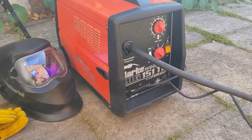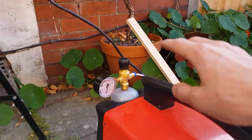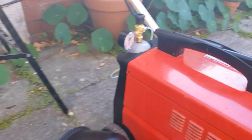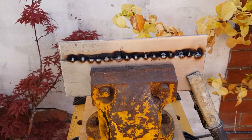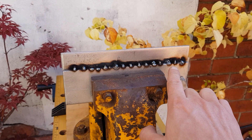I'm going to be using my new Clarke Weld 151 Turbo with a new regulator on top because the one it comes with is a bit of rubbish. I've got my welding mask, gloves, and the torch. I've been testing different welds - different wire speed, different power - to try and anticipate what it's going to be like when I weld the wishbone. I'm hoping for something with nice penetration without splattering when the wire speed is too fast.